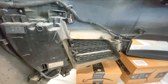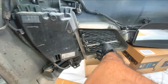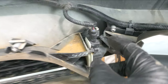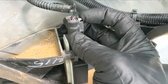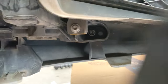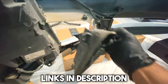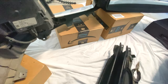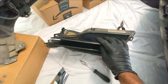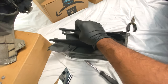Now here's the bonus clip — this is where I also installed the silver trim and the fog light. You can see the fog light right there, and the silver trims are behind these electronic louvers. Unplug the little harness and take out the screws using the torx bit — I've left the link in the description. This is also plug and play. I prefer the OEM chrome look that came with the higher trim of this vehicle.